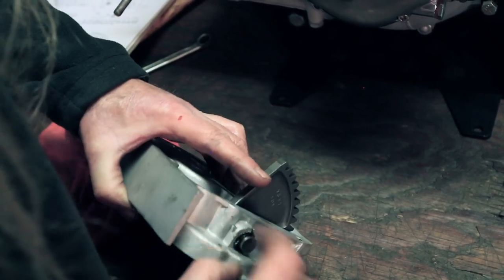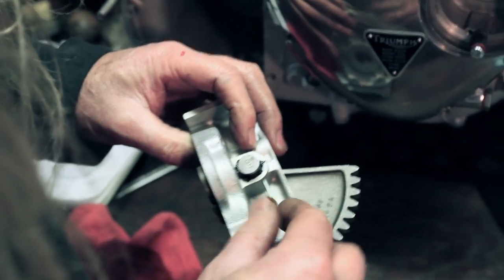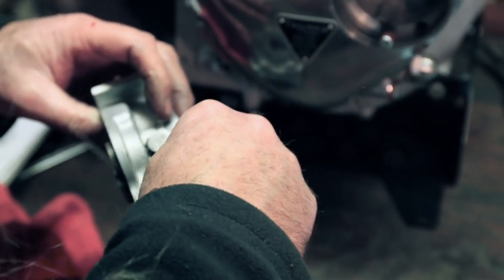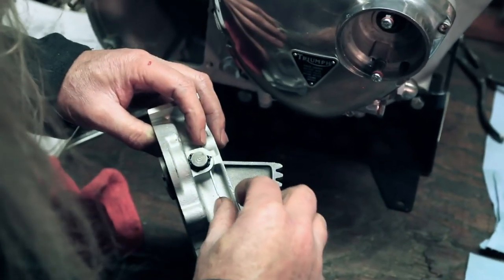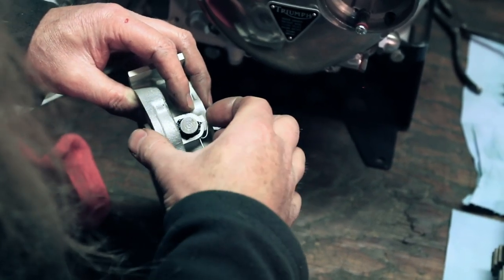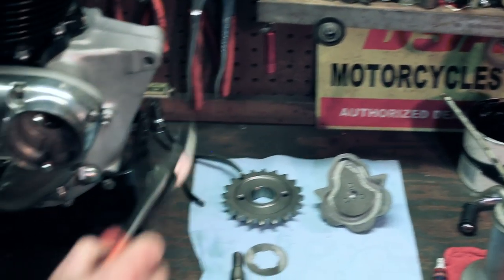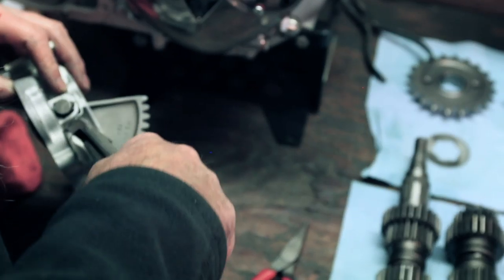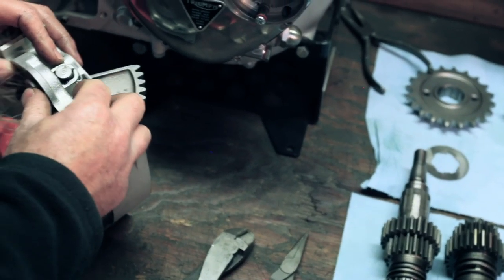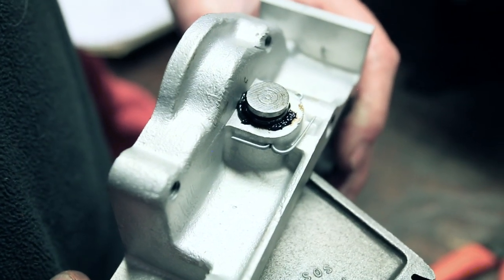And we're gonna orientate the cotter pin, the head of it, so that we can, now we'll turn this around so that we have the long side facing this way. These are actually a little longer than necessary. And then we're just gonna bend that up like so, past the gasket surface, and bend that one down. We can actually trim that just a skosh, so it'll go down all the way. There we go, that one's installed and bent over.